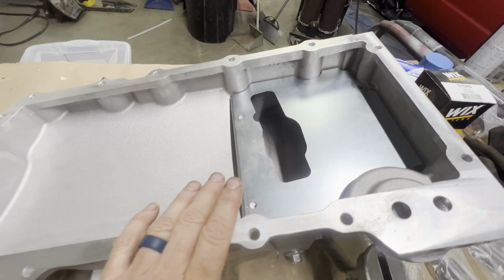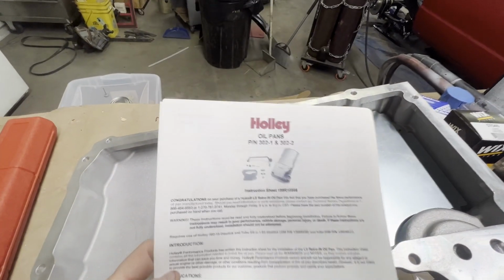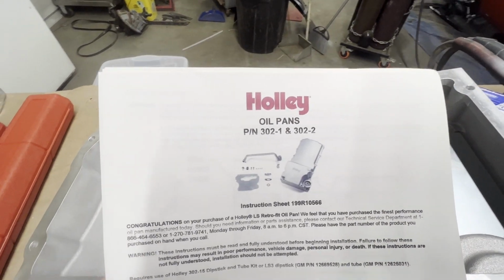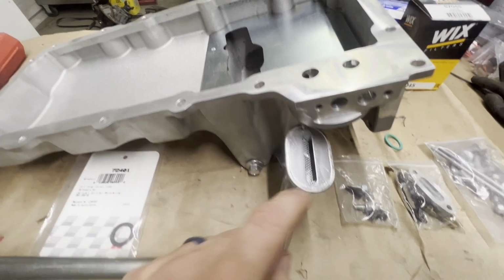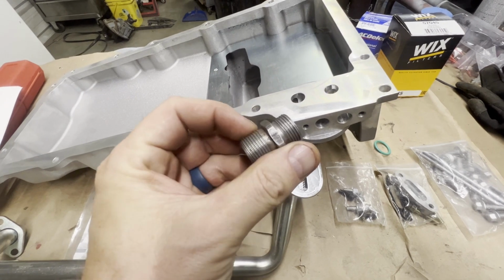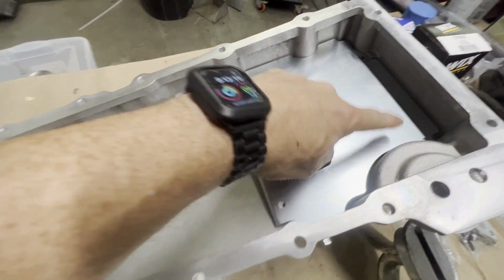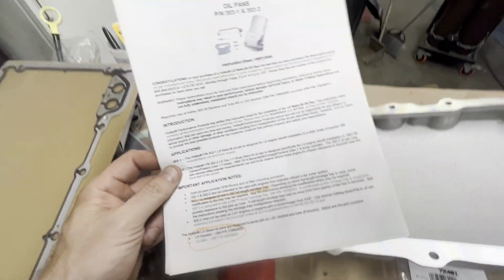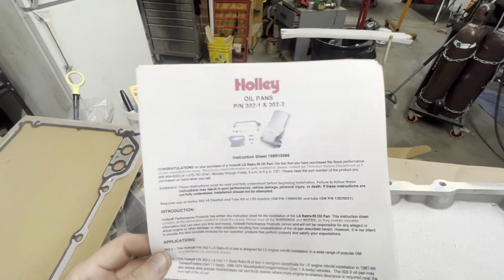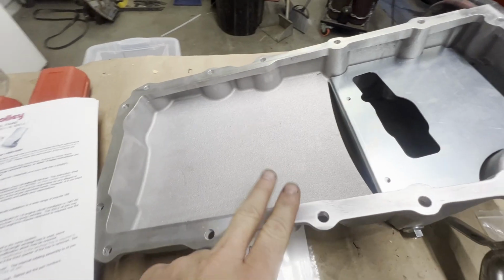This oil pan does need to be put together. It did not come with any instructions. One of the things that I found, if you go to Holley's website, you can download the instructions for the 302-1 and 302-2 oil pan, and it has all of the torque specs for your oil pan bolts, which I know none of us guys torque those, for your oil passage, your oil filter adapter, it's 40 foot-pounds. Then it tells you what these bolts torque to. You do put Loctite on here. I'm not going to read this all to you, but as I put this together, I will call these out. But I will leave a link to the PDF for this in the description box of this video so that you guys will have this, because like I said, this does not come with it.